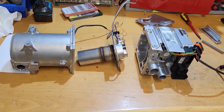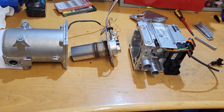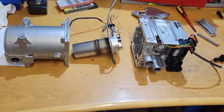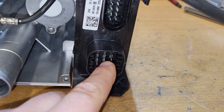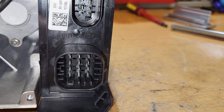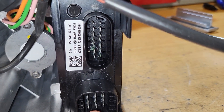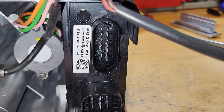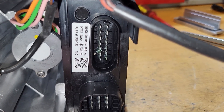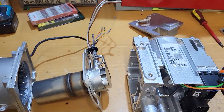After seeing this, we got the heater and I didn't even connect it to power because it was moist all over these connectors. Even now you can see there is still some oxidation. It's interesting what kind of antifreeze they are using because it's all dried out — here in the workshop if I drop a little bit of antifreeze on the floor it will be there for months.